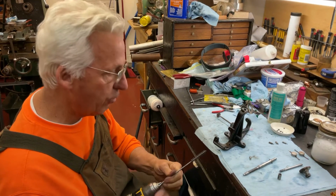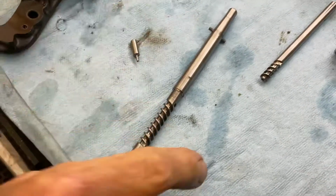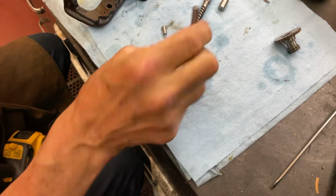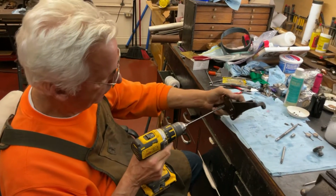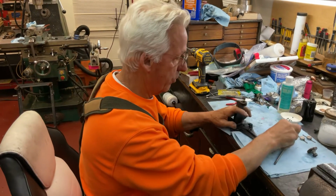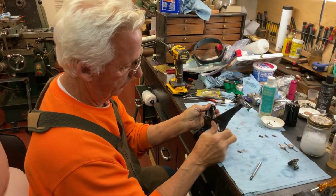But I always talk about polishing all the running bearings out. See, on the spindle shaft, I've polished this out at the end where it fits into this bearing, because we had wear marks because nobody oiled this thing. And I had wear marks up here. I also, on the governor shaft here, have polished everything out. I've cleaned out the ends in here, and there are little ball bearings in there, and you have to be careful. So we'll take this piece right here, reinsert the bottom bearing, and reinsert the spindle shaft. It needs a little bit more.